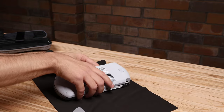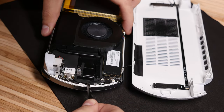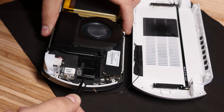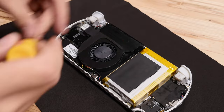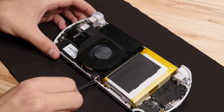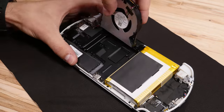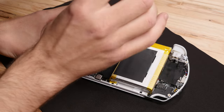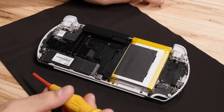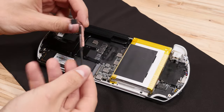Just be careful with the cable for the two back buttons and the Wi-Fi antenna. You don't have to remove these cables, however for ease of working on the unit I chose to remove them. Once you're inside, the first thing you'll have to do is remove the fan unit — this only has two screws, one connector, and a piece of thermal tape at the top which you'll want to peel off carefully so you can reuse it. I'm also taking out the three screws found underneath the fan, which allows you to remove the first part of the heatsink and access the back of the battery connector.